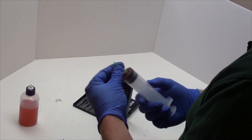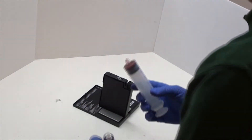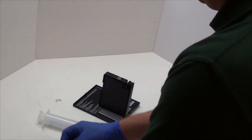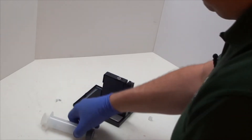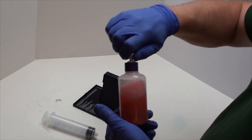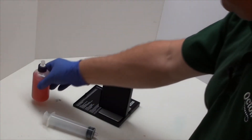So that is how you refill a Pro 1 cartridge using Octoinkjet refill tools and ink. In terms of cleaning up: disconnect your adapter, gently press your bottle a tiny bit so it's got a bit of negative pressure, reattach your syringe and then squidge it all back in. Then clean up your adapter, clean up your syringe, flush it out, and place your cap cover back on your bottle of ink — and that's ready for next time.